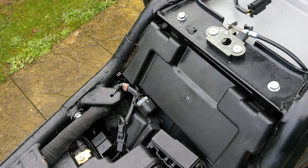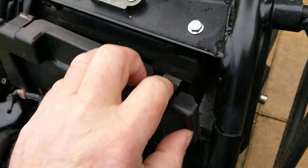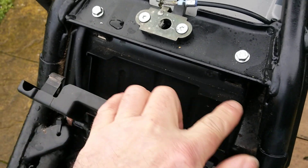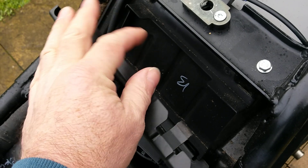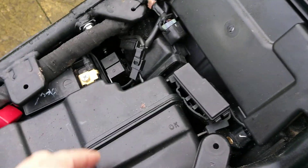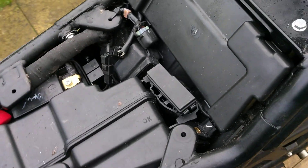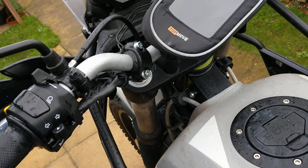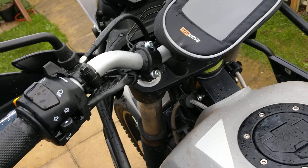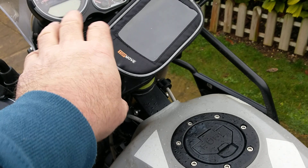We have a little compartment on our bikes just here. They say this section is for the handbook, but unfortunately the handbook doesn't fit - it sits up about 15mm, it's too big. So I might utilize this space for the fuse box. I might be able to move a couple of cables around and just sit it in there - it's fairly small. I will do a video of the install. It will feed my USB device, the LED lights, and potentially heated grips - though I don't believe in them. I'll use a multi-core cable from the fuse box, run it up underneath the tank, and it will be soldered and heat-shrinked to each device at the front of the bike.